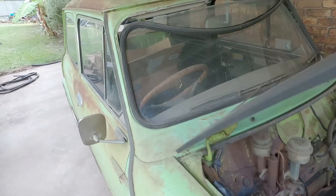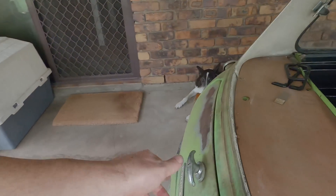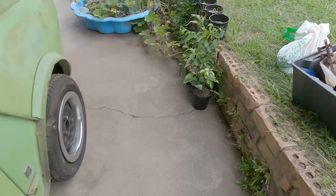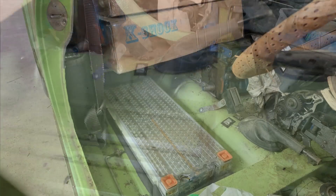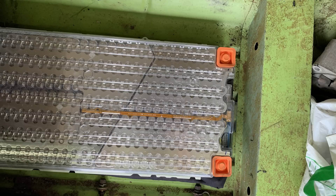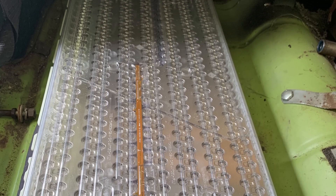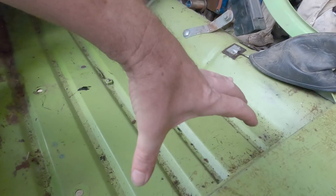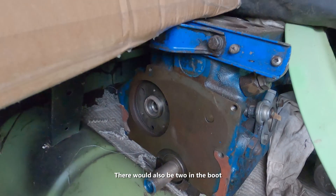The bonnet itself is in great condition. The eventual plan I think will be three Tesla modules underneath the bonnet along with the motor and controller. I'll probably put the charger in the boot because I want to be able to charge it anywhere, so I want to have the most universal charger I can possibly put in it. On the inside I would like to see a Tesla module here and a Tesla module over there.